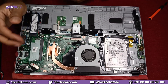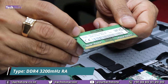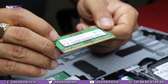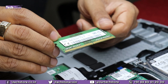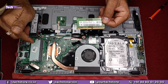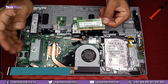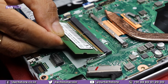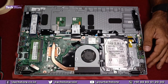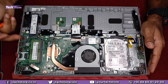Coming to the RAM: you need to take a 4GB, 8GB, or 16GB DDR4 3200 MHz RAM — whether it's a Core i3, Core i5, Ryzen 5, or Ryzen 3, you need 3200 MHz only. Unfortunately, one RAM is already soldered onto the motherboard, so you can only upgrade to another 16GB. That means a total of 20GB is the max upgrade capacity of this laptop. Just take this RAM, install it and press from the top, and the RAM is fitted. It's very nicely designed in terms of upgradability, although we would have expected two RAM slots.